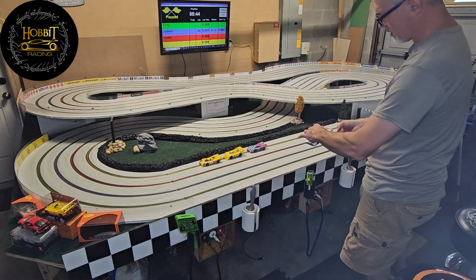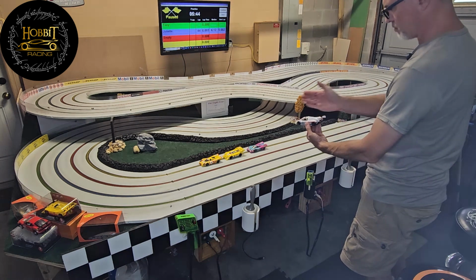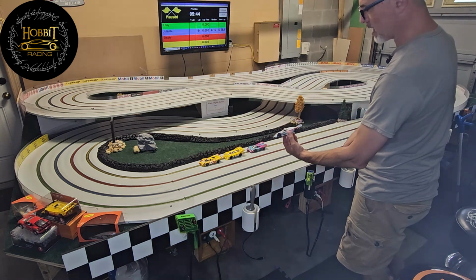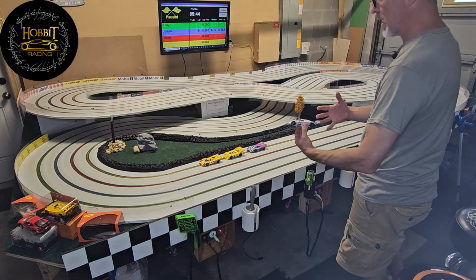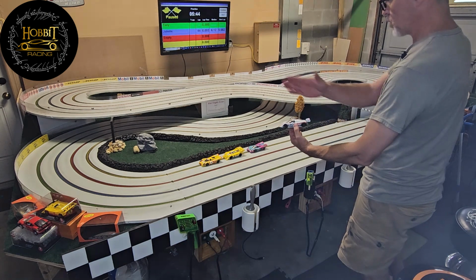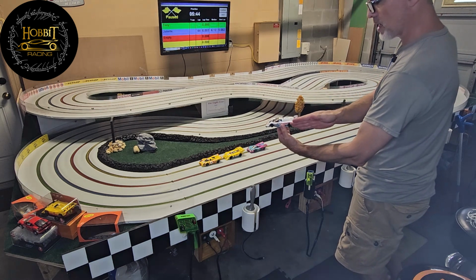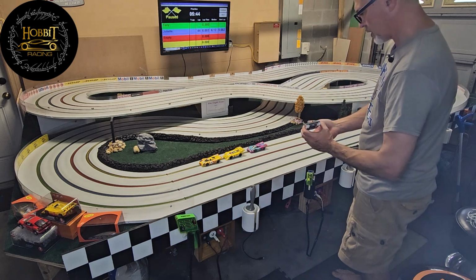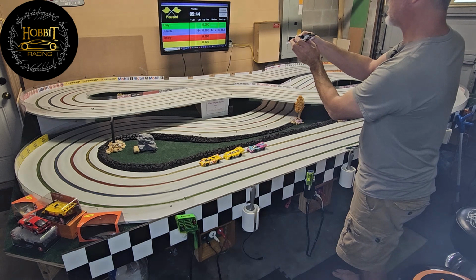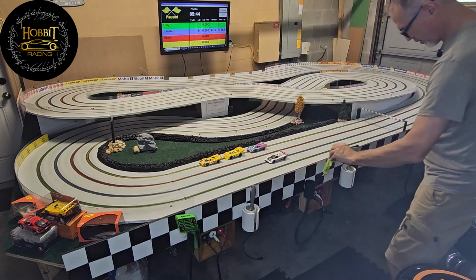The tire on the left-hand side of the car, as you're looking down the car, I suppose, we'll just call it this tire, and everybody will know what I'm talking about. It receives the most wear on this track because it's the most right-hand turns and the most force the car feels is the rear tire on this side, of course. So you just want to check the wear-in points as these 44 laps in. You just want to check those wear-in points to see that even on both of them, you're getting nice wear points.